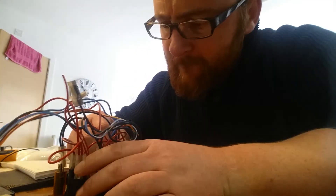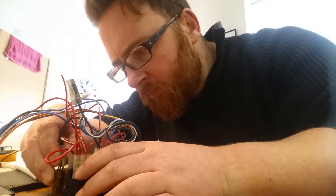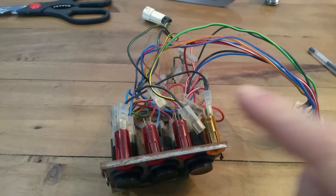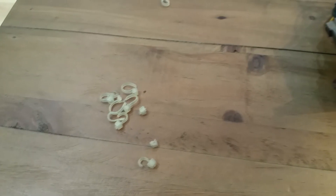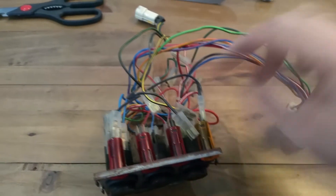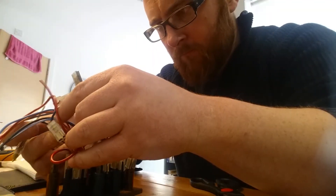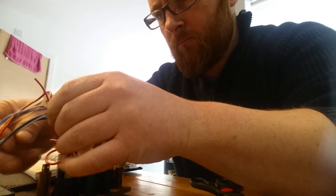One last task to do, and then we're done for the day. There's a fault on the headlamp panel to the right of the stereo. Specifically, it causes the lights to go on and not turn off again. Simple fix, right? To make life a bit easier for myself, I've started to take all of these nasty old cable ties off that hold all this together, and we're going to remove some of the extraneous loom now.